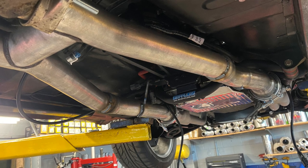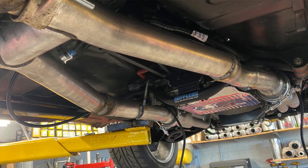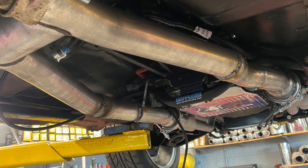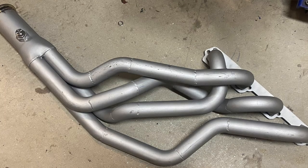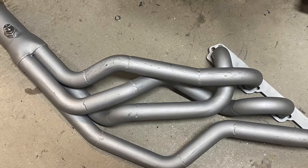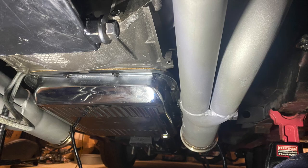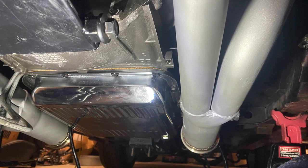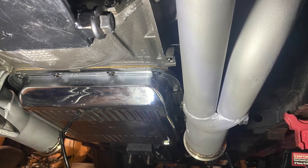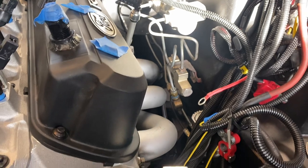It became one gigantic headache — arranging a trailer, getting a shop appointment, etc. Word of advice: make sure you mock up with the AOD cable on there. You'll thank yourself because you'll see immediately if your collector is running into it. Also, when you buy headers, have the O2 sensor bungs pointing outward — outboard to the car, not inward — because especially on an AOD they'll probably go directly into the transmission pan. You might get away with inboard on a T5 manual, but not on an AOD.